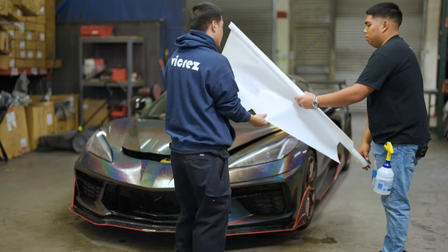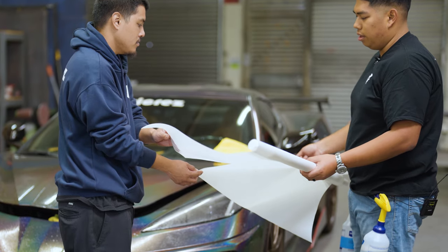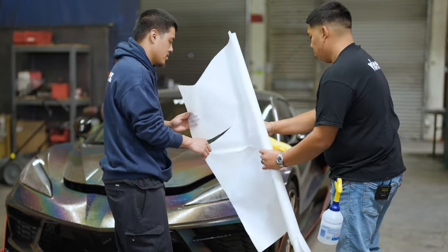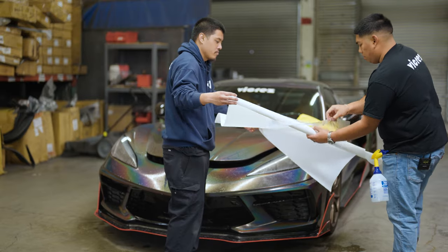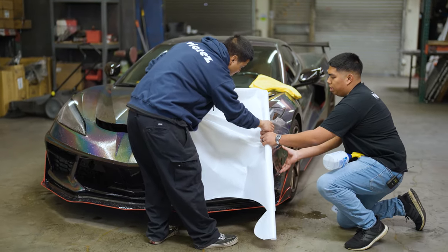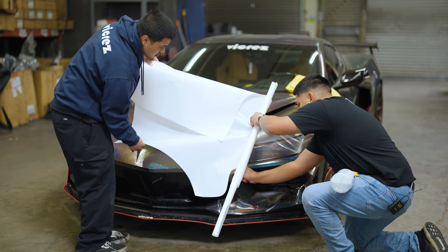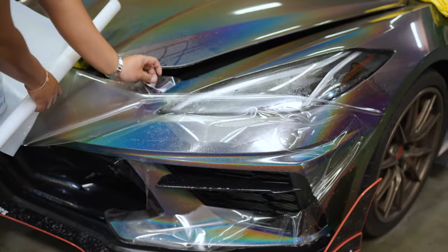So we're going to be dry rolling the bumper on. This bumper will require two people. You're going to have one person unrolling the bumper onto the car and then the other one's going to hold it up, make sure it doesn't sag or fall to the floor. So we're going to start with the driver side first. With your pre-cut kit you're going to start pulling off one corner and you're going to tack it onto there. So pull one side up, just take your slip solution and then we're going to start tacking this and you're going to pull. So I'm holding it in place as he's pulling and in that process you're basically reverse rolling your pre-cut kit. The placement doesn't matter just yet since we're laying the film, so we're going to lay all of our film in place.